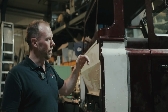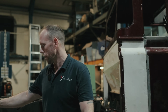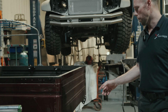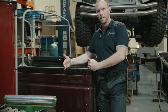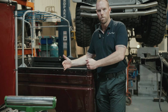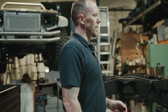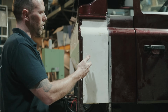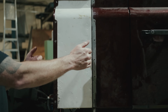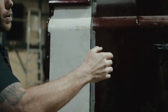So we're gonna give this car a bit of a king cab twist because that's the rear body. And we've got to lose about this amount. I think it's about 450 mil, something like that. So what we've got to do is, we mocked up in the yard, we had a rear body. This is just for mock-up purposes, so ignore the scruffiness. So what we're gonna do, we're gonna extend it by this much. We're gonna join this part of the body to this part of the body.